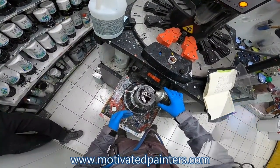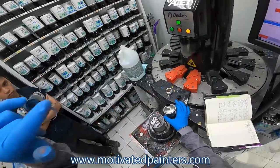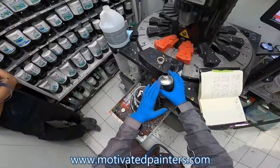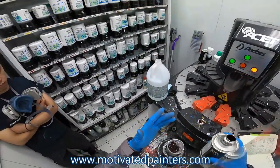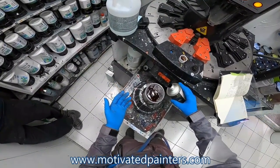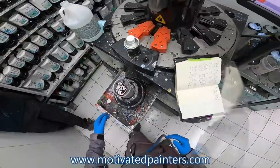is because that way I can apply the clear coat a little bit heavier without having to worry about, so what I've noticed with this color, some of the problems sometimes is that if you put on the whole entire thing, then you put a heavy coat of clear coat, you've gone too far. So you can't go back, you know what I mean? You've gone too dark with this, and there's no turning back. When you put half of it, you have a little more wiggle room because you can apply it heavier, but still not go over the edge to being too dark. Because sometimes this color would only need one coat, but it's very hard to apply one coat of tinted clear perfectly smooth. You understand? Okay, good, I'm making sense. For once in my life.